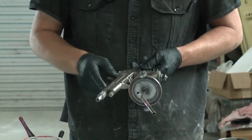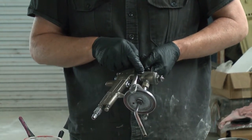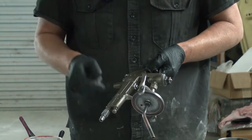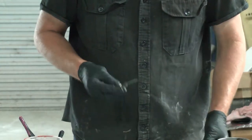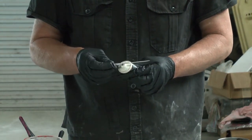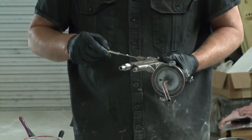There's a little seal just in here — as I talked about before — and that stops air entering. These are suction feed guns, so if you've got air leaking into the gun, it's going to spit when it's painting and cause problems for your paint job. So that needs to be lubricated. For many years, I just used a few drops of engine oil on the needle as I put it back together, and that works well. Spray gun grease is better, but not absolutely necessary.